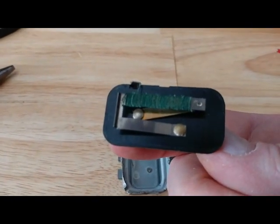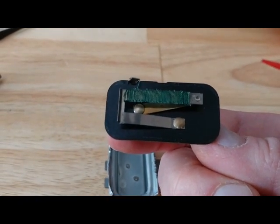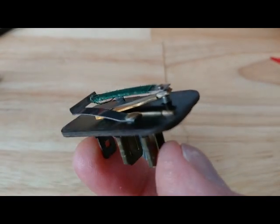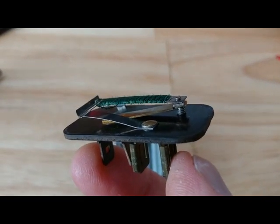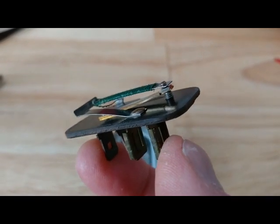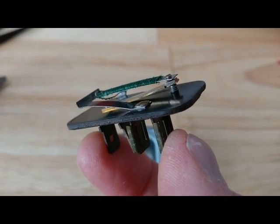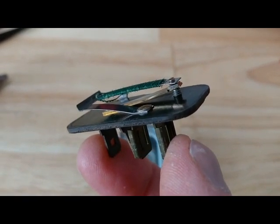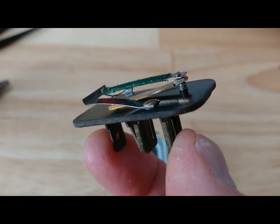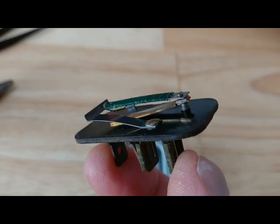What we've got here is a green wire that is attached from the battery to ground that heats up. It's wrapped around a bimetallic strip. The bimetallic strip then has a contact over at the right, a point that opens and closes pretty rapidly. What I think is so magical about this is that point has a screw thread where it attaches. If you change the screw by adjusting it, you can actually change the voltage that this regulates to, which I think is just absolutely magical.